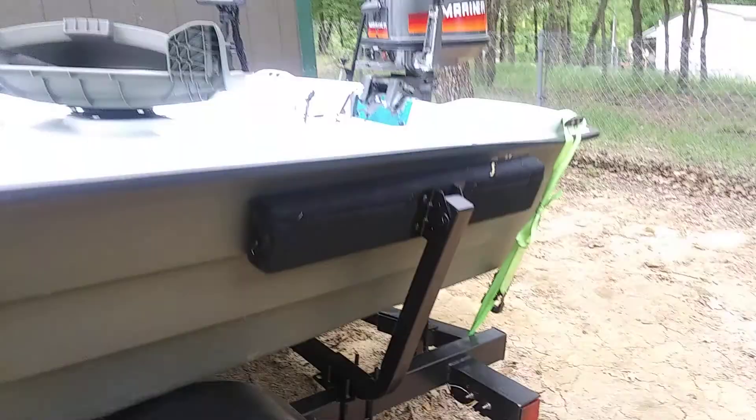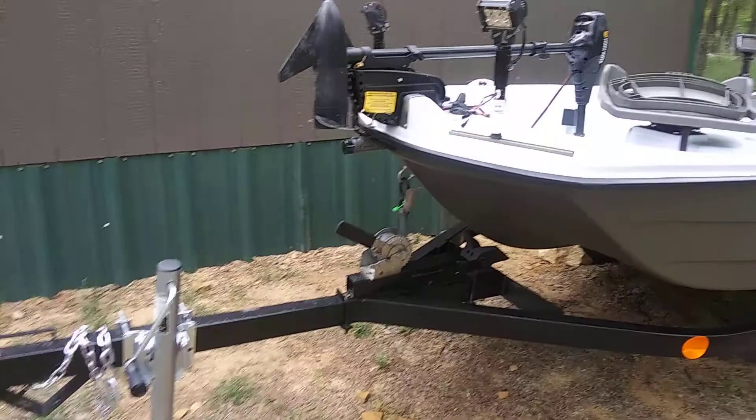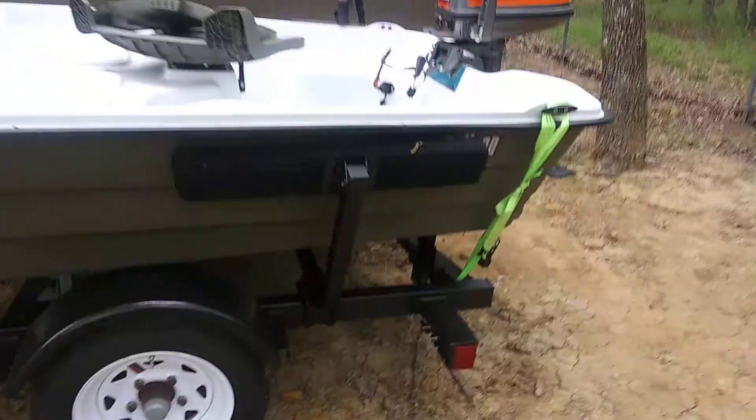That's mainly just to keep the boat from wanting to come off the trailer. It had some plastic reflectors on there. One thing I still need to do is raise it about another two inches so it'll sit properly — the boat was wanting to sit on the fenders. I put a dolly on the front with a new chain and lock, new wiring with new waterproof LED lights.